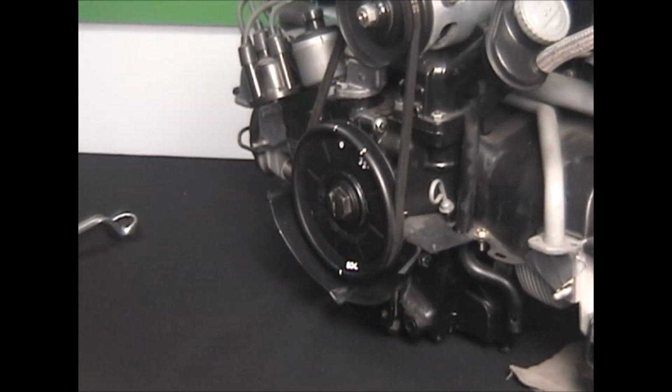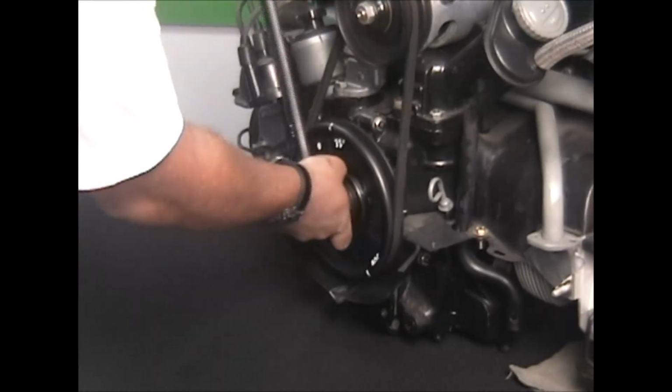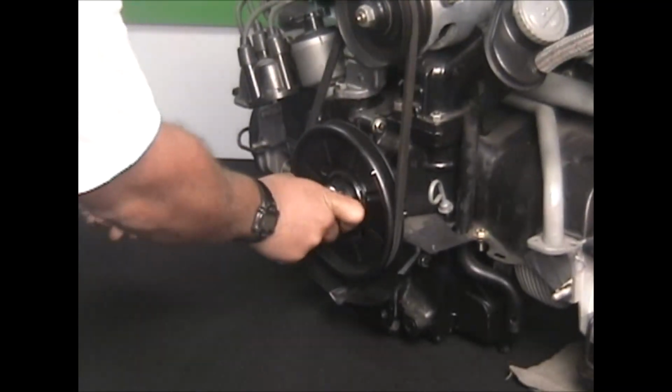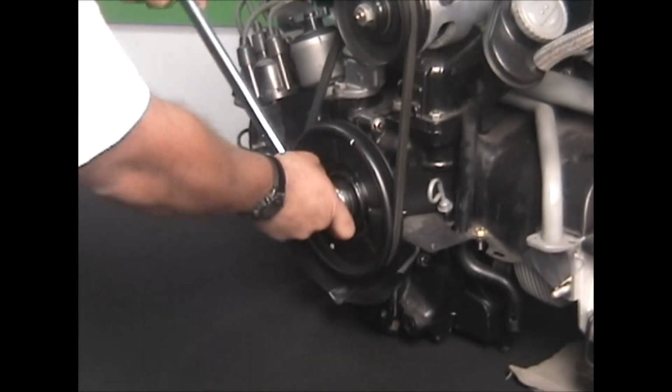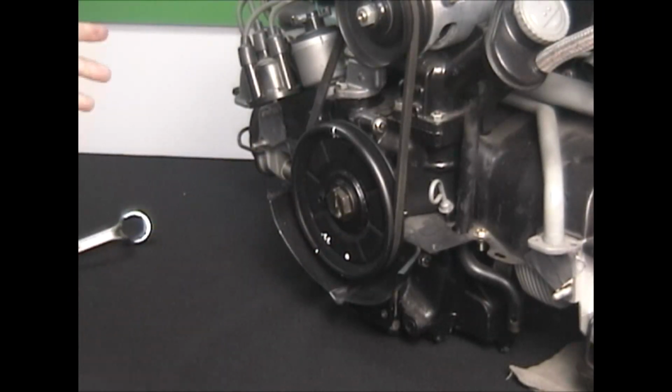Pop the valve cover, check it first with a 6/1000 feeler gauge. If it's tight, adjust it. If it's loose, adjust it. When we're done doing any adjustments we need to do there, we take the pulley one more time, 180 counterclockwise, back to BDC, bottom dead center, and now run number 4. Once you're done with number 4 cylinder adjustments, you're done as far as that's concerned.